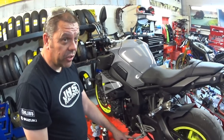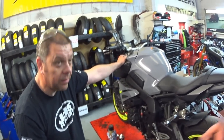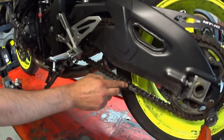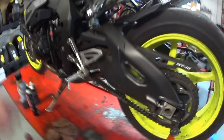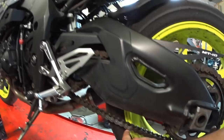If you get any tight spots in the chain, that's where the pin is worn in the roller — it's finished, chuck it away. But your chain is perfectly serviceable, it's just very dirty. I purposely didn't lube it because I wanted it to look rubbish for the demo. Just visually — that point to that point on that stretch — it's minutes of work. Do a couple of rotations, give it a couple of passes, and it'll come back beautiful. So there you go — that's how to turn that into that, and with even more time, even shinier.